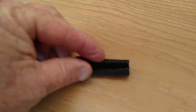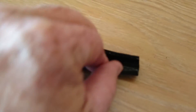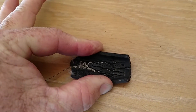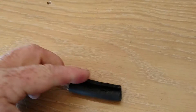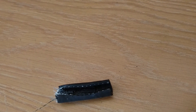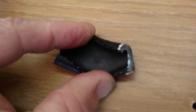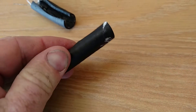One of them is a brand new fuel hose, and the other one is what came off my plane, so take a look at this and see for yourself. This is the old fuel line, and you can see where it ripped — it just tore in half when I went to pull it off the barb on the fuel filter. You can see that it's rotten, and when you grab that fuel line and pull on it and stretch it lengthways, it creates those cracks, and you never even know it because they're inside the fuel line. It's actually causing mechanical damage to the inner liner that you can't even see. This is a brand new piece of fuel line, and you can see that inside it's all nice and smooth rubber. That's the difference.